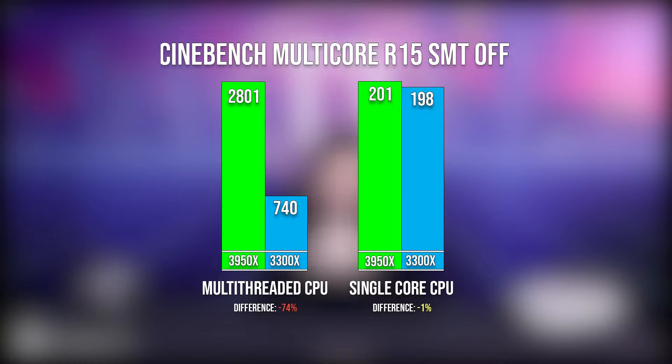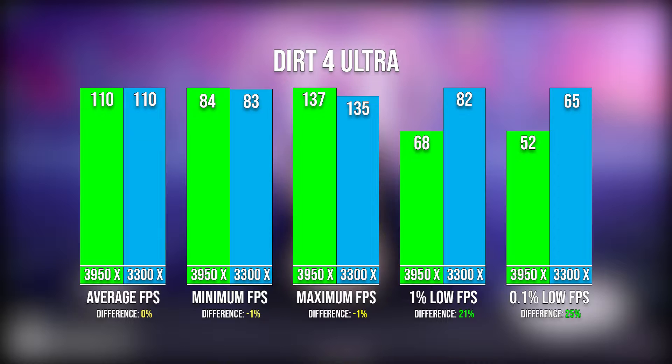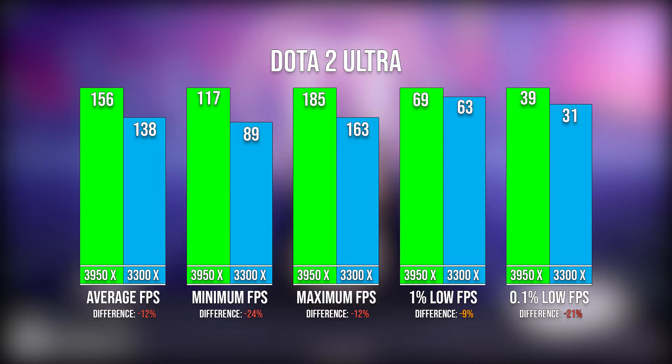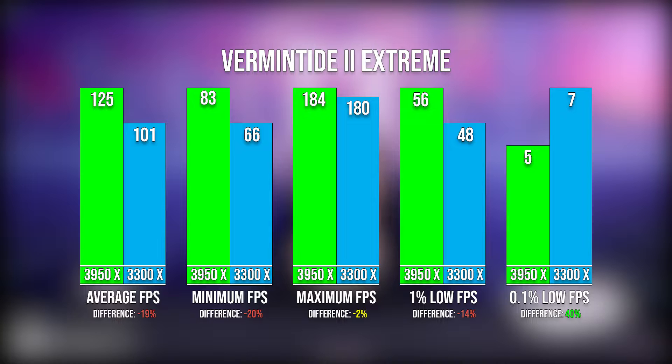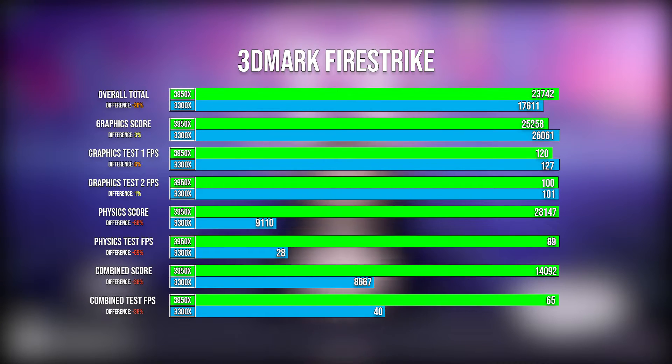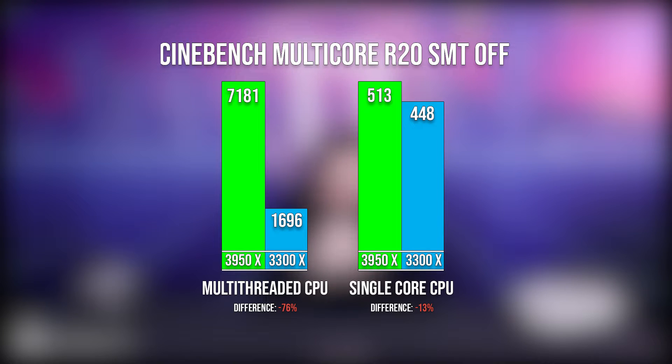A Ryzen 3 and a Ryzen 9 actually come basically from the same piece of die. The quality of this little 3300X especially, compared to a high-end die like a Ryzen 9 3950X, is absolutely phenomenal. Looking at benchmark scores and my testing, you'll notice the single-core performance of the 3300X is almost an absolute dead heat with the 3950X. Of course a 16-core is going to absolutely smash a 4-core in multi-threaded testing. But for gaming you don't really need much more than a quad core, and what they've created here in a $120 chip is basically a 7700K that you can still overclock and get even better performance out of.